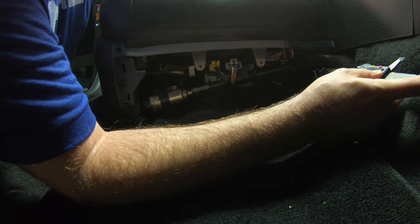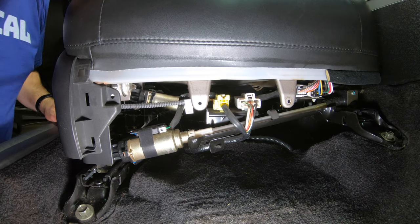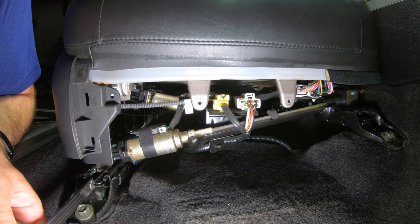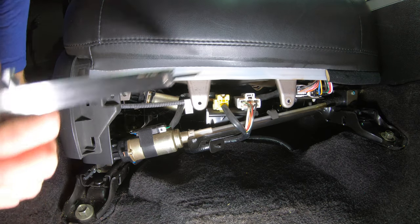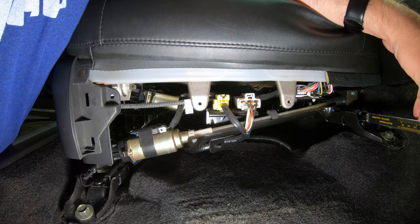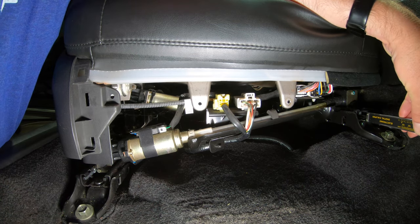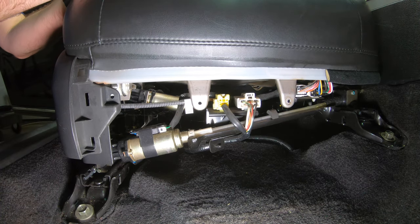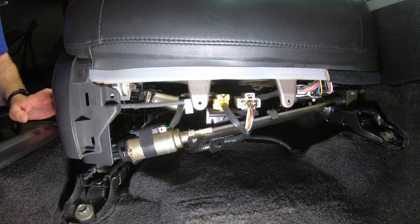That one's 1.8 so let's move the seat. What I'm doing is measuring from the front of this steel frame to where that motor mount is — this is 1.405 and comparing it to the other side, that's 1.388, maybe 1.408. So I think right now I have this seat as perfectly centered as I can on the rails, so when I take it out and change the gear hopefully everything stays aligned.